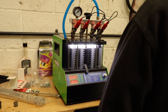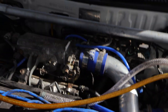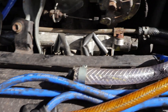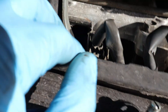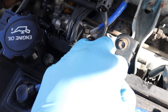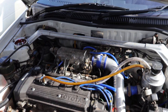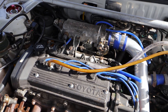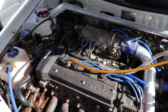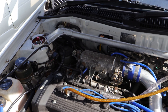So these injectors are faulty. I've already fitted the new injectors in the GT — as you can clearly see, the injectors are in and plugged in. So what I'll do now is plug in the computer — it's got the 430 injectors now on the E-Manage. I'm going to start it up. It does have a fuel pump to fit, but I'm going to start it up and see if that was the issue first.